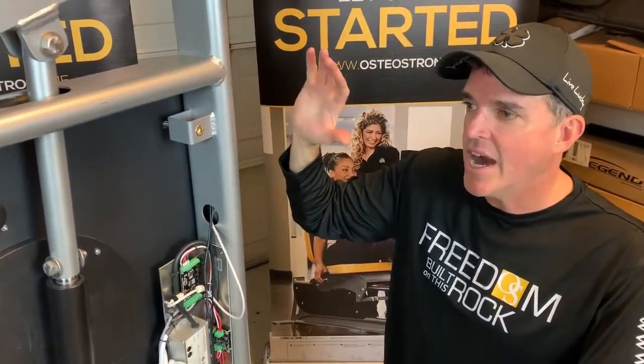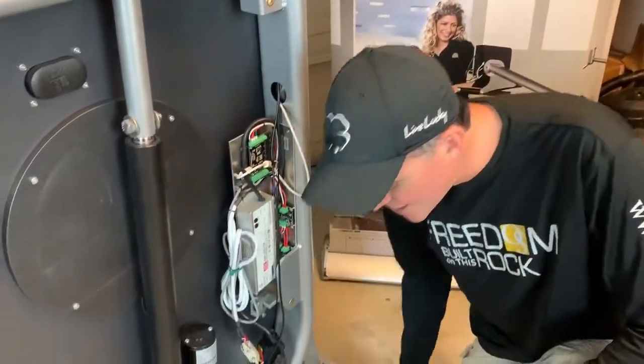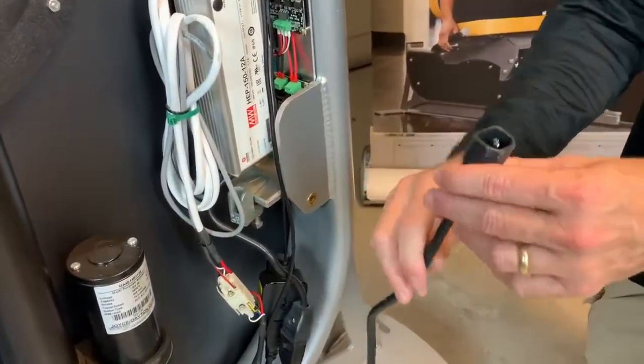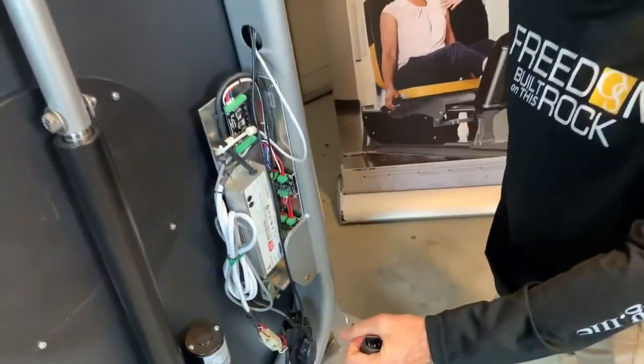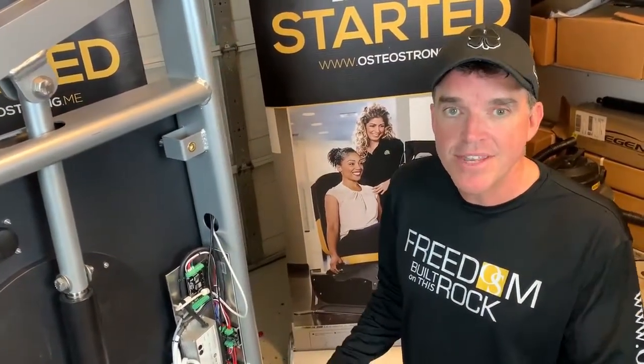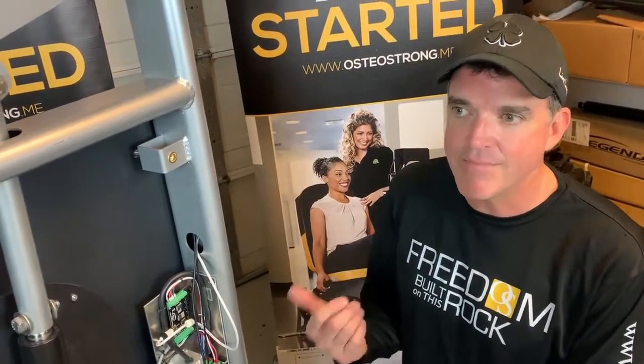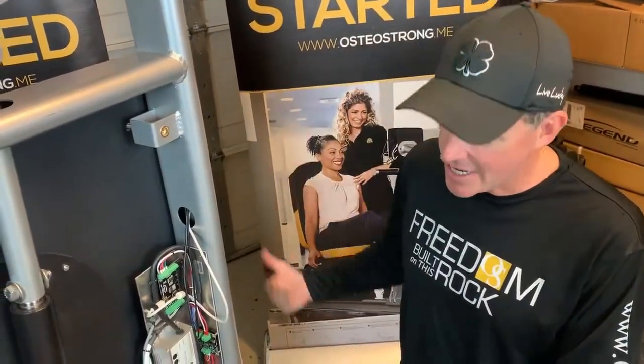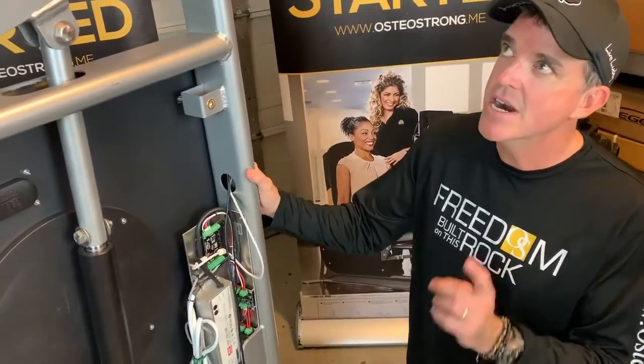Surprisingly, the issue is often outside the machine. This plug will plug into the next piece of black cable that plugs into the wall, and it may become loose. Do yourself a favor — check that easy fail point first. Check the plug in the wall, make sure the outlet has power by plugging in something you know works. I've seen a failed power strip that was clicked on but had no power, so start outside the machine before working your way inside.